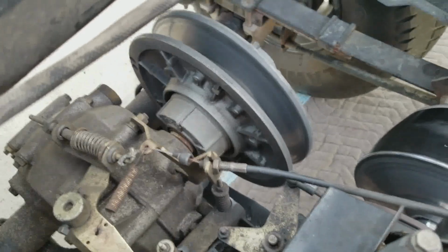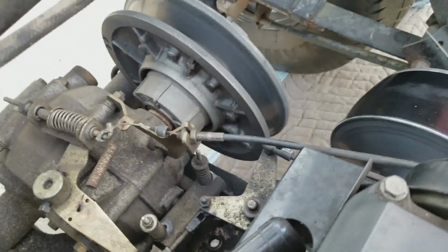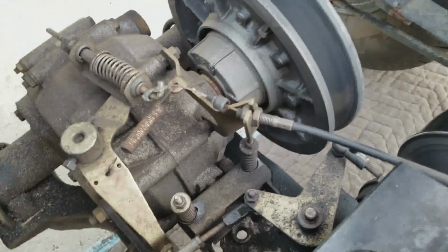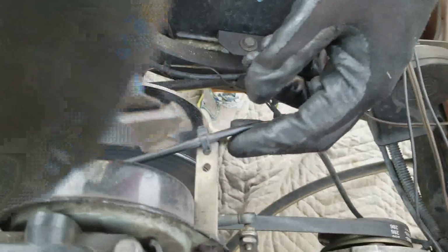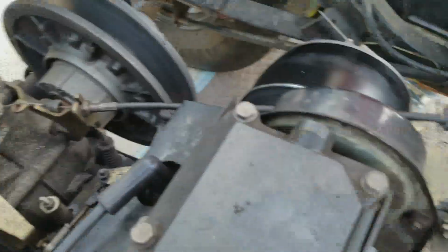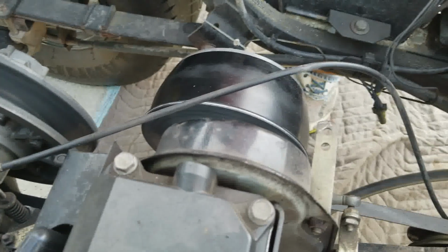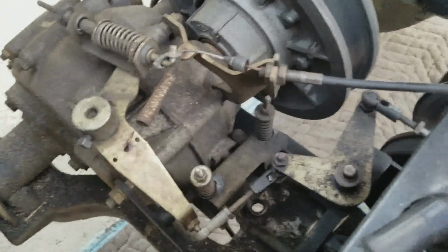Okay. Good. All right, next we're going to remove the throttle cable. I have an OEM zip tie here. I'm kidding, I don't know where this is from, but we have a zip tie here. I'm just going to release it from the zip tie first. The throttle cable obviously goes to the throttle, through the throttle linkage back here. But anyway, the zip tie be gone. Okay, and then I'm going to, this linkage on here, I'm just going to pull it off of there.